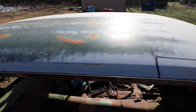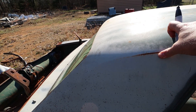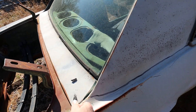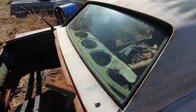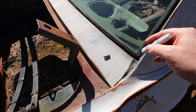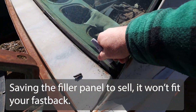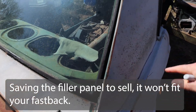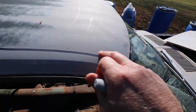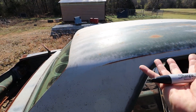You're going to cut it up to there, then come back here and take your sawzall or whatever you've got. Since I'm giving up on salvaging the top, I'm going to cut it right here all the way back — and obviously I would have already pulled that window out. That's a good window; if somebody needs a coupe window for a 67 or 68, it's right there. I'm going to cut the top here and here, do it on both sides — the top's going to be cut loose here, I'll take these spot welds loose on the front, cut here and here, and then lift this whole thing off. It's gone.